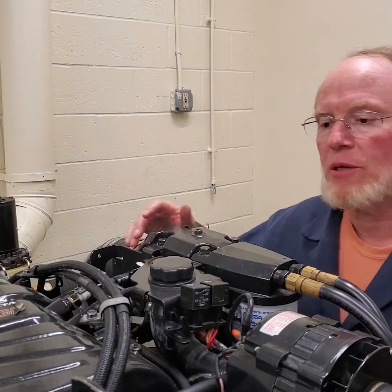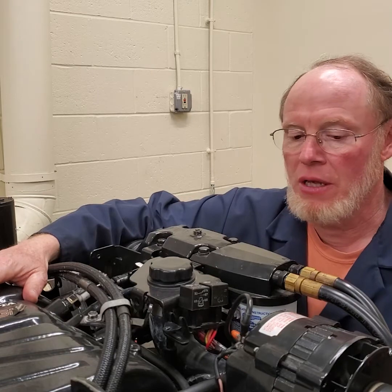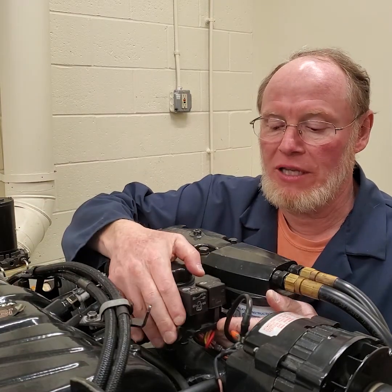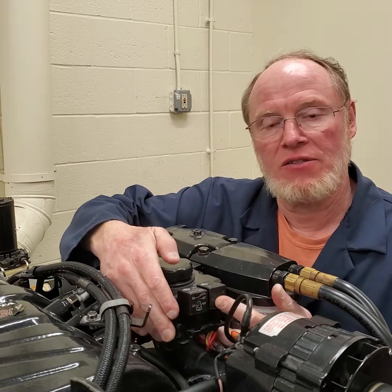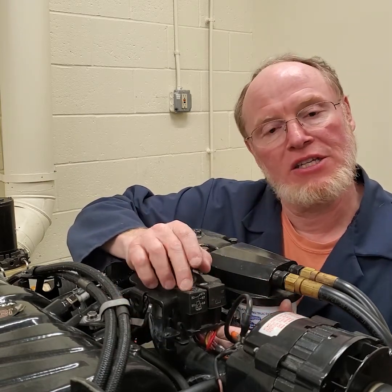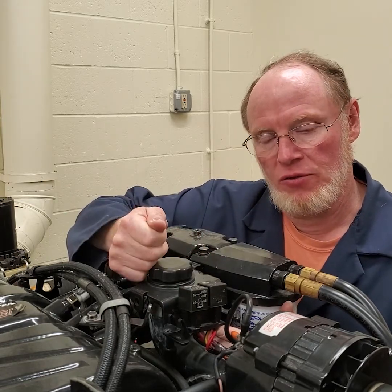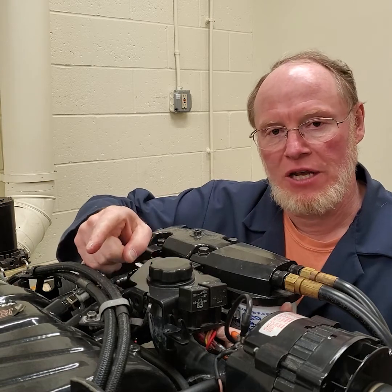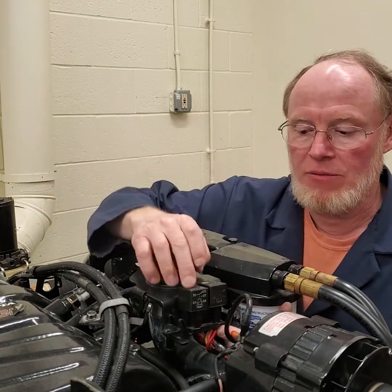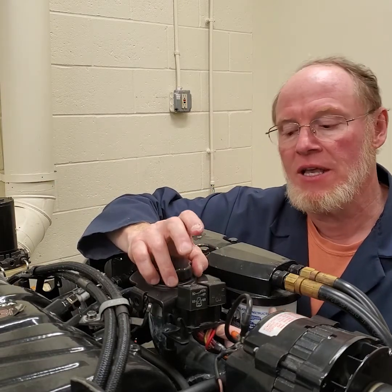In this video I wanted to talk a little bit about fuel pump circuits. We're working on one of the lab engines here, an old 7-4 that has the older style relays — the full ISO relays. There are two of them. One of them is for the ignition, which basically comes from the key switch, so when you turn the key switch on, power comes from the key switch out of the ignition wire purple, comes down through the harness and energizes this relay.